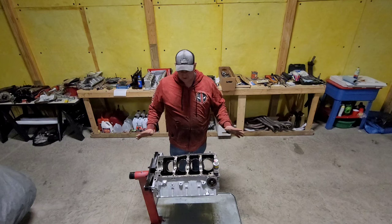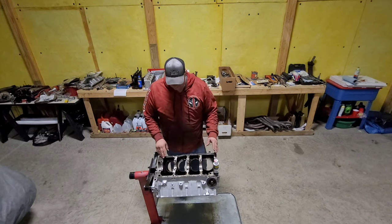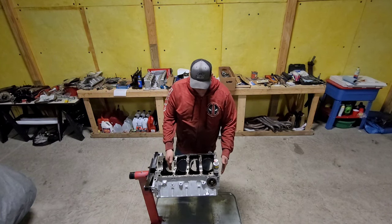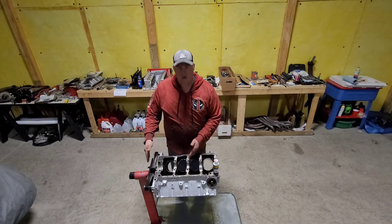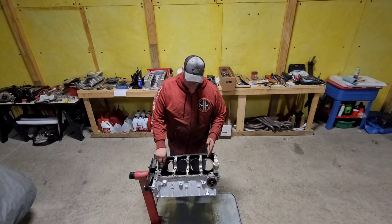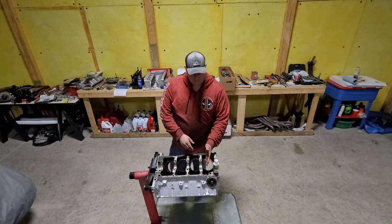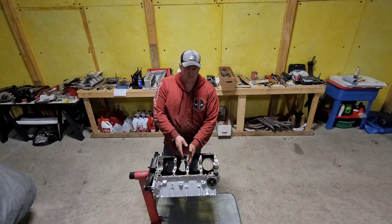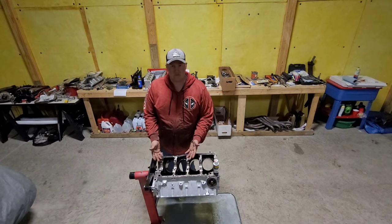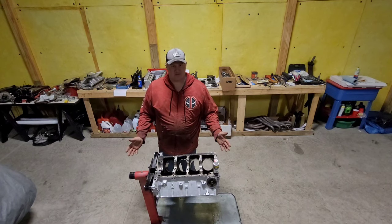So, to start this off, I personally like to put the camshafts in first, mainly because back here it's kind of hard to get to. You don't want that cam to nick the bearings all the way through. It's always good to put just a little bit extra assembly lube on this back bearing, because you can put it on, but as you go through, you lose a little bit, lose a little bit more, and by the time you're back here, there's really nothing else to lose. Hopefully you primed your engine good, because your back bearing's probably thirsty.